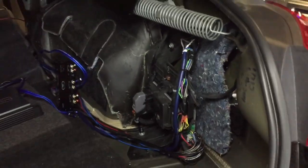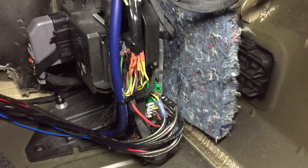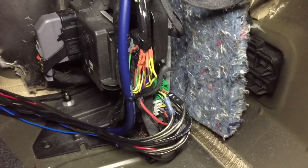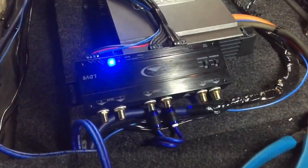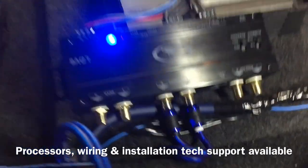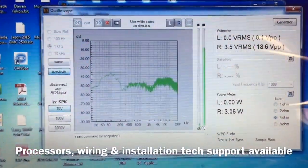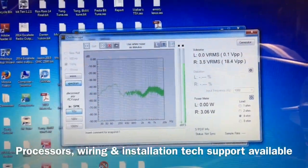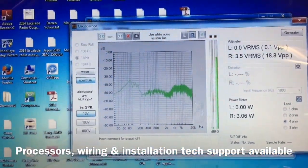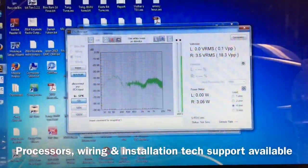Still in the process of wiring this up, but basically in the back passenger side quarter panel there's a factory tuner amp, and there are all the wires and everything you'll need to access. So we have our summing unit here — got the RCAs coming out. We're measuring on the RTA, and as you can see now it's summed both of the signals. So then what we need is a Bit processor — an Audison Bit processor or something — that'll flatten that out. That's the factory EQ curve there, so something like that would flatten it out and help things sound a lot better. Then you can EQ from there.